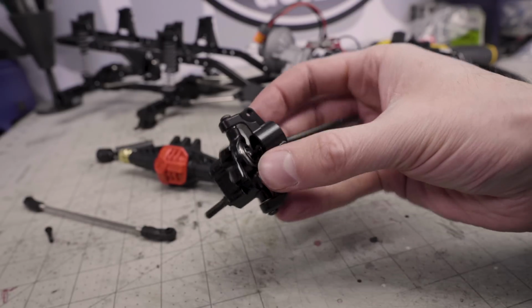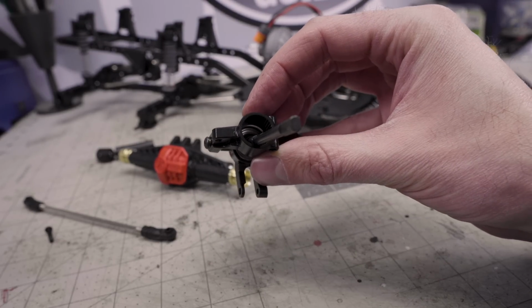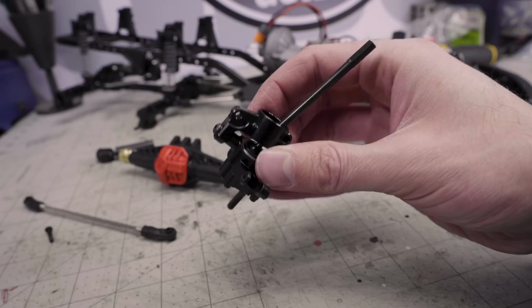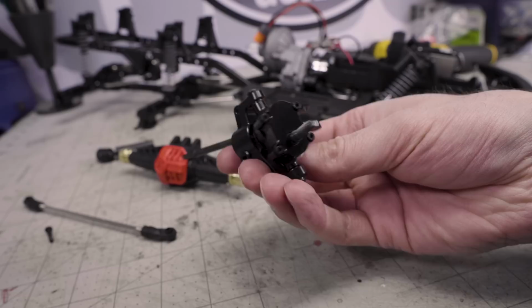So thank you, Dan. Because I'm using those stock housings and only modifying them slightly to accept the splined portal box from RC 4-Wheel Drive, all the links and everything just mounts right back up where they're supposed to go. Not a lot of actual modification required. It's very much a bolt-on, plug and play, and you're ready to go.